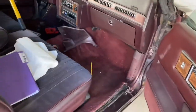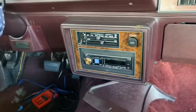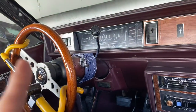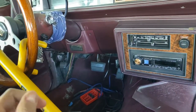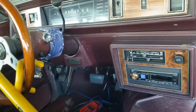All right, it's Sunday morning. What do we have left to do? We ran the power, ground, ran the speaker wires, put the glove box back in, put the new stereo in, cleaned up the bird's nest back there. Now I have to run the driver's side speaker wires and go from there. Clean up some of that stuff, but it's minimal now.